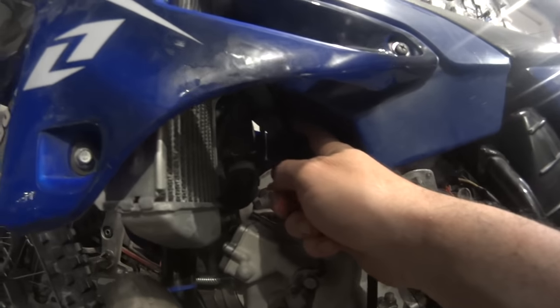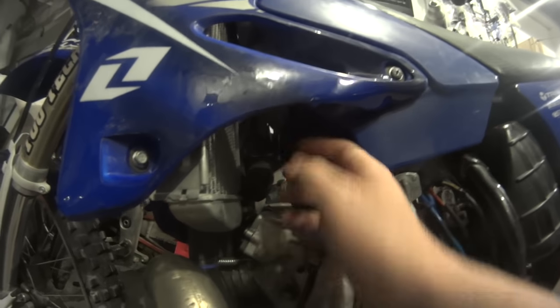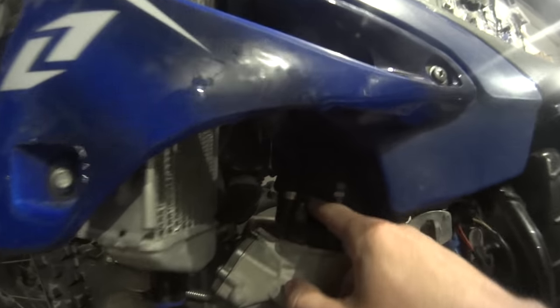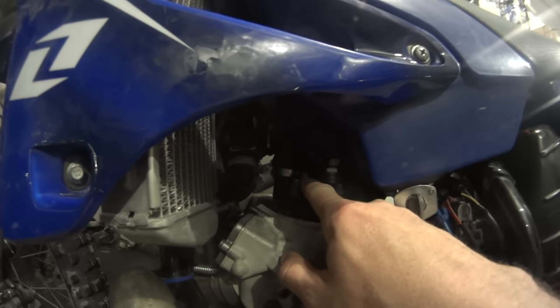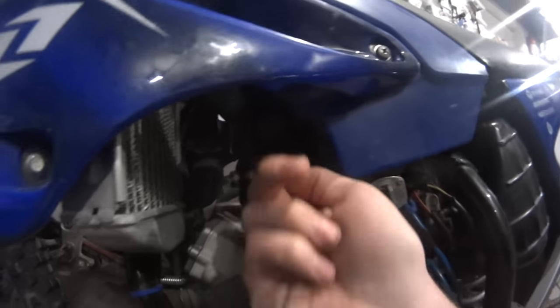You'll have to take the water out because you'll have to take the piston out. There is a hose over here with a little clamp. You will have to take this clamp and remove the hose. But before you do that, very, very important - on this side of the bike there is a drain bolt. You'll have to drain all the liquids out. So take this drain bolt out and all the liquids will come out of the radiator. After that you'll be able to remove this part over here and take the hose off.